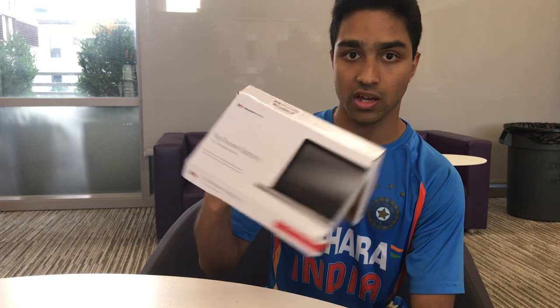Now that we have finished installing the battery, we have to fully charge it. Then we want to calibrate it — let it go through one or two charge cycles from 100 to zero. There are specific instructions on how to do this in a video by the company NewerTech; I will link that below. Besides that, this has been your autistic tech boy, Dabarshi. See you in the next video.